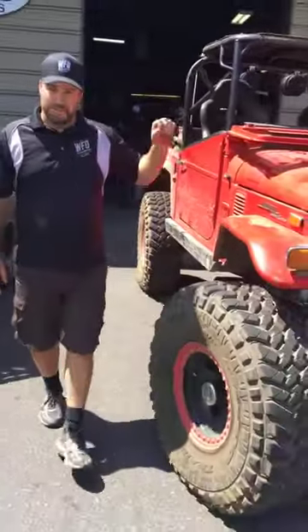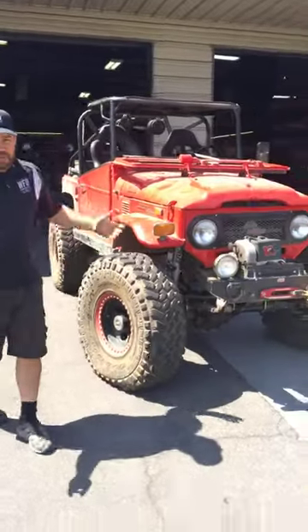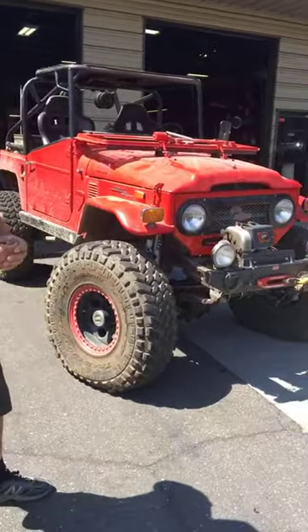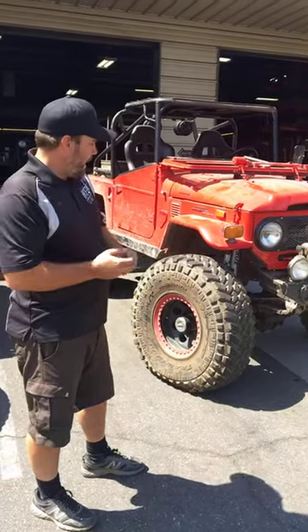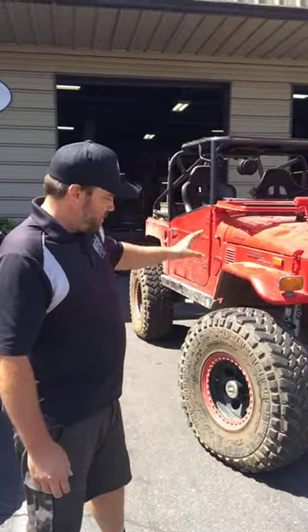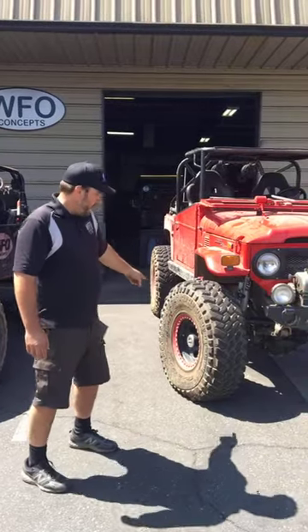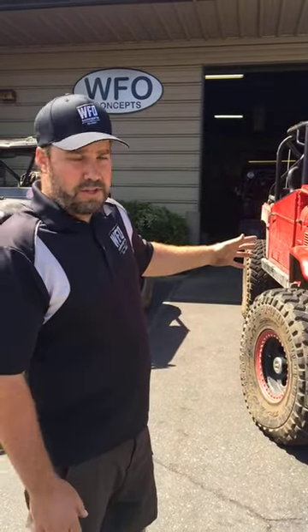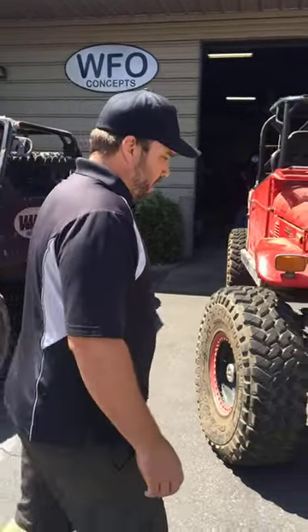This FJ40 is one of my favorites — you've seen pictures and videos of this already. This is Dan's — he's a local guy. About a month ago it had stock axles in it, and now it has a Dana 60 front and a 14-bolt rear. We do narrow axles and build axles here as well. We took a Chevy 60, narrowed the long side down to fit the Land Cruiser leaf spring width. It's got a Chevy 60 with chromoly axles — we sell all Yukon axles — with 35-spline outers. The rear end is a cab-and-chassis 14-bolt. When you narrow the long side for a Cruiser or CJ, the cab-and-chassis 14-bolt comes out 63 inches in the rear and about 65 in the front — makes a perfect package. Alan built these axles over in the diff shop.